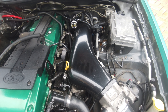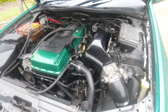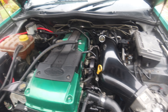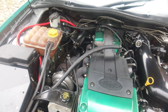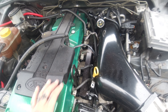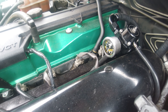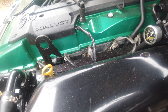Then we get into the fun stuff. We got the Plasma Man top-half intake plenum — just the top half, not the full thing — with a stage three intercooler from Plasma Man. And a four-inch Plasma Man airbox and Plasma Man intake — pretty much everything is Plasma Man on this build. We also have the Plasma Man dual-entry fuel rail with 1250cc injectors, coming in on both ends with the return in the middle, and Race Works 1250cc injectors as well.